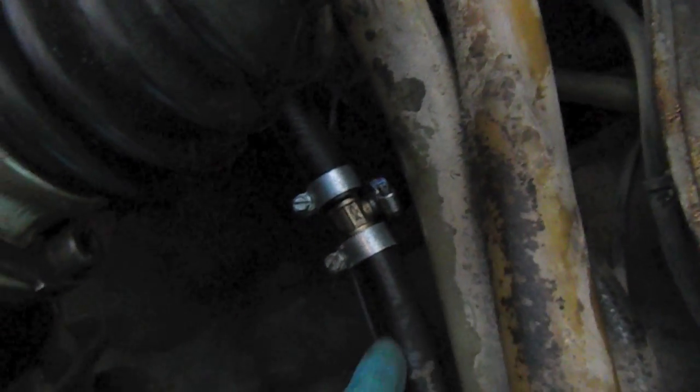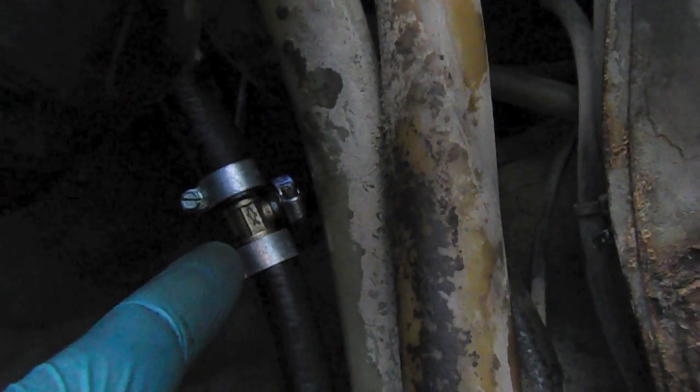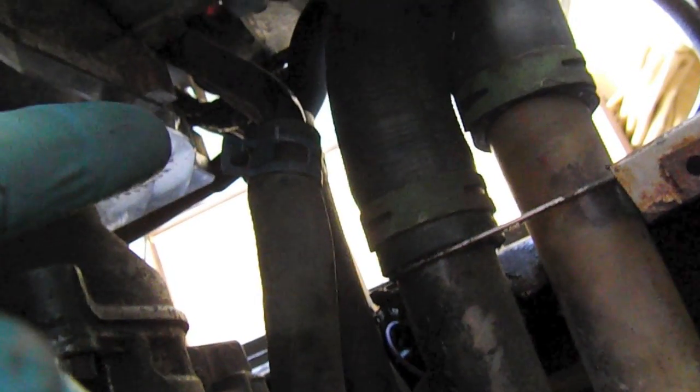Now I'm under the right side of the van — the passenger side. Here's the passenger side CV joint, and here are the radiator tubes. We've got the T spliced into the heater hoses right here. There is the T going to the rear heater core, and if we follow the line up there's our bypass T. Continuing on, you can see the connections to the engine itself — that's where I ended up putting them.